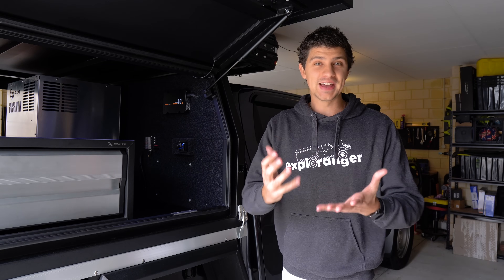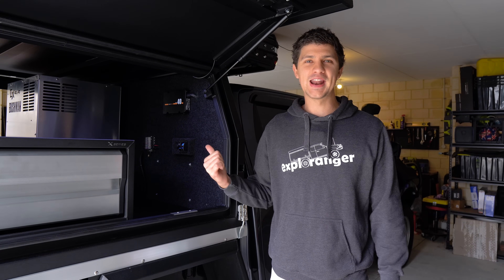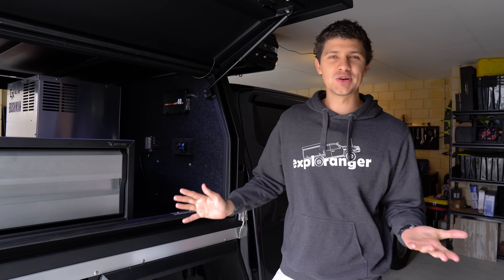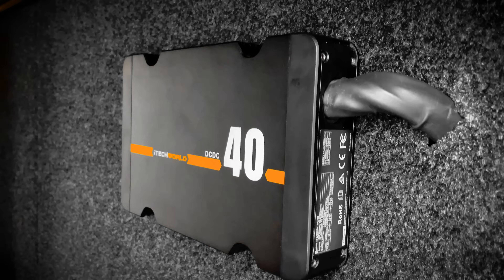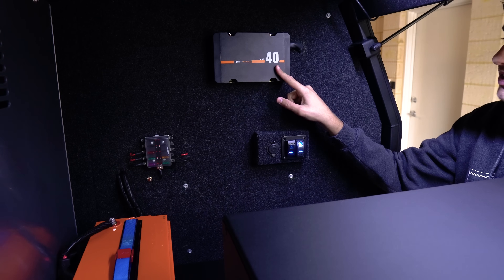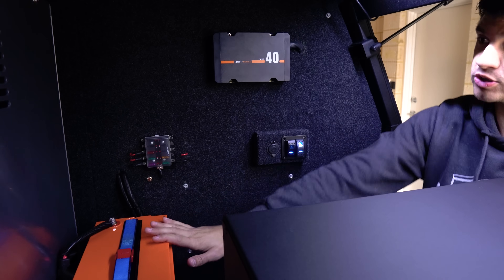After a few really long days and even longer nights, the new 12-volt setup is fully installed and working a treat. It did take a bit longer than expected, but I'm not a professional — a lot of this stuff I was figuring out as I went along. I was trying not to cut any corners and get everything done to the best of my ability. Starting from the top, we've got the 40-amp iTech World DC-DC charger to take care of charging the lithium battery — mounted nice and high, and this should charge that battery nice and quick. All the cabling runs behind the headboard, coming out and going to the battery mounted behind the fridge.